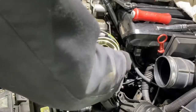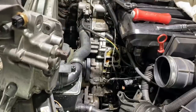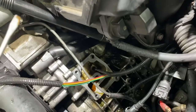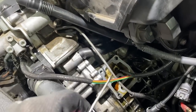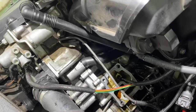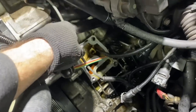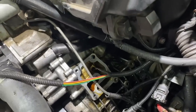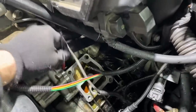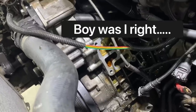I'll make my day a little bit better. All right. I thought this was gonna be a speedier repair. So it is blind, I have that much depth on it. I almost just bought a helicoil that would have matched this exact same size, but I didn't. So now I gotta go back to the parts store and go buy it. Anyways, we're gonna have to go in here and thread repair the block for the oil filter housing right here because someone over torqued it. They put too much stress on all the threads. This is an aluminum block, so you have to be gentle. It's gonna be one of those days.